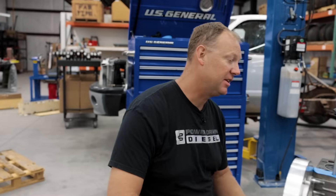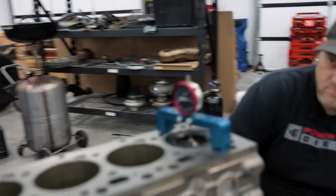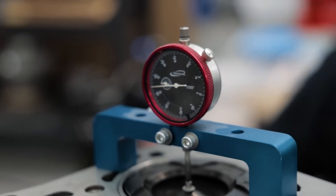What we're going to do is go a little bit before top dead center and a little bit after, then split the difference. There's dwell time where the piston kind of sticks at the highest point for a couple of degrees, so we want to get right at top dead center. Tell me when you're ready — you're going to hold that measurement when I call it.